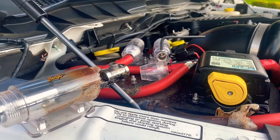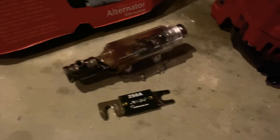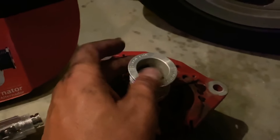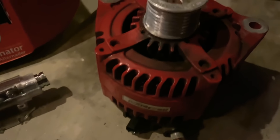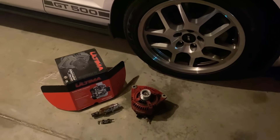We found out the culprit of the nearly-fire burnt fuses. This is a brand new fuse that I actually witnessed lightning-bolt pop. It was the alternator — the pulley seized almost to not moving at all. We need to order a new 370-amp alternator, but right now we just got a 220 from O'Reilly. That'll keep the truck running. I couldn't figure it out until I watched that fuse pop and then I could hear the alternator working really hard. This one's charging the batteries now and we'll be good to go until the 370 comes in.